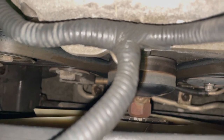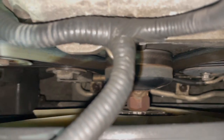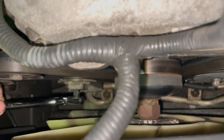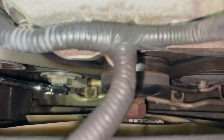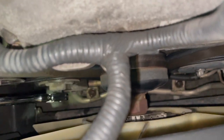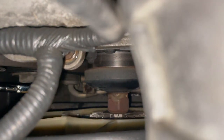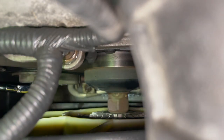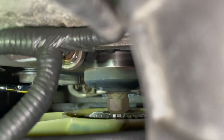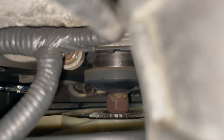I'm holding the camera with one hand so I'm not sure I can do this, but — there we go, I'm moving the pulley, taking tension off. That's a lot of tension off. Now I can basically pull the belt off. I'm going to free it from the water pump — I'm not even going to take the belt all the way off, just leave it dangling to the side.